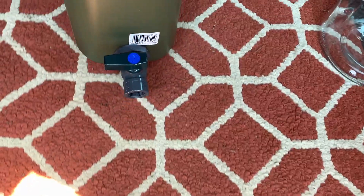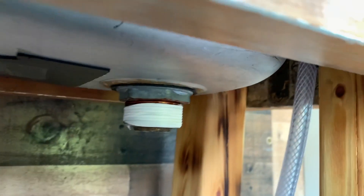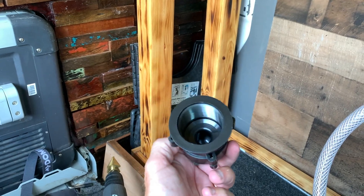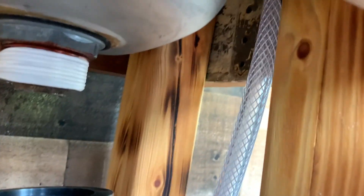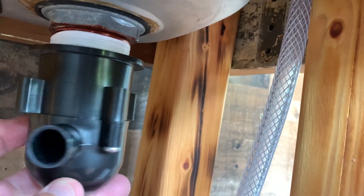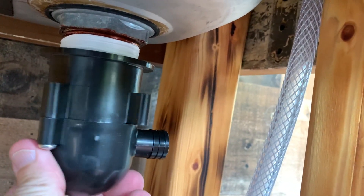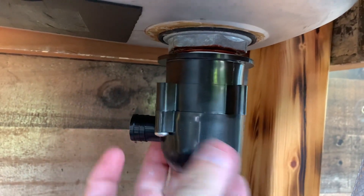So beware if you're tailgating me, because I'm gonna let her rip! There's the drain on our gray water. Next we're going to put our trap on our sink. I've already put some plumber's tape on it — that was hard to find anything, so I went online. Got this p-trap from Camco that fits these sinks and it will just go on here. As far as I know they'll just be hand tight. I kept trying to cross-thread but I got it, and this will just go on up here like so.